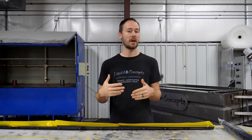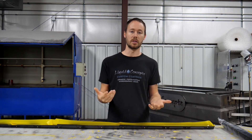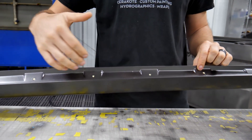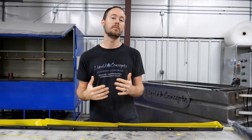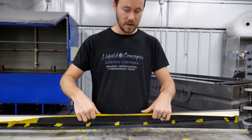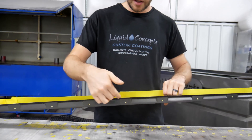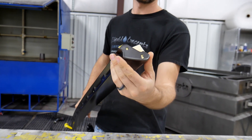Whenever I'm doing large pieces like this, I always want to try to overthink it, so that whenever I go to dip it I get the best possible result — it stretches everywhere it needs to — and I'm not wasting film, because if I'm wasting film I'm losing profit. You can see I've got holes all along here to actually bolt this onto the car. I went ahead and plugged all of those up with just some tape on the back side — just slits of tape torn off — covering all the holes along this back side and on the front as well.